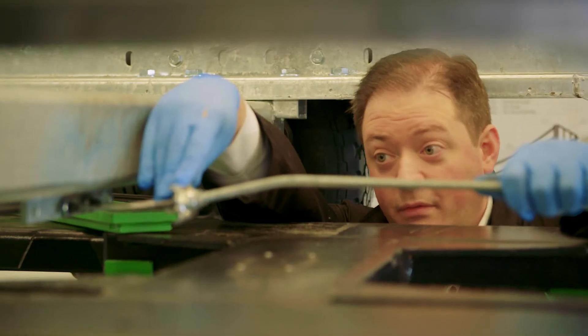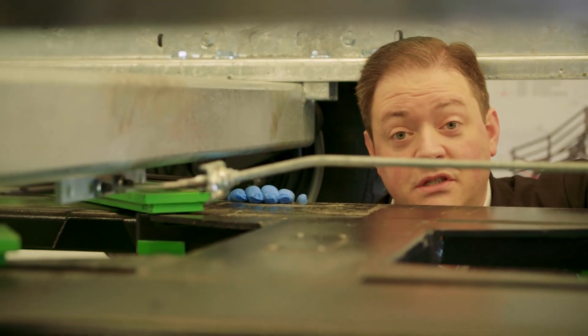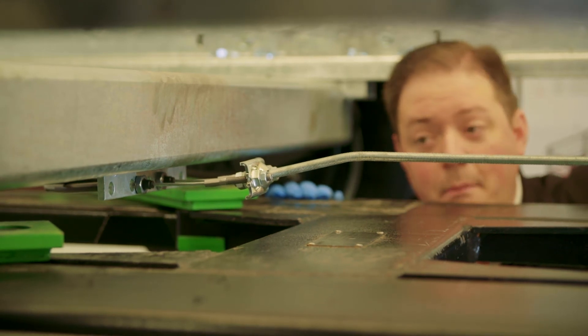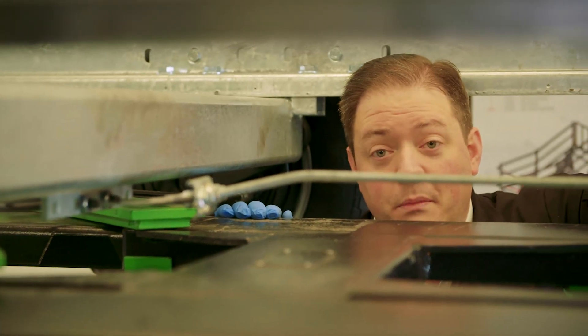Once that's done, I will find that my handbrake lever comes to approximately the 10 o'clock position. If it hardly lifts at all, then I've over-adjusted the brakes and I need to come back and make sure that there's some slack or allowance for movement within the system.